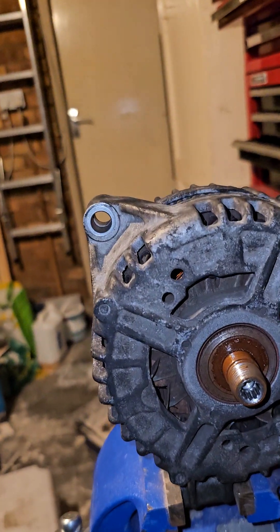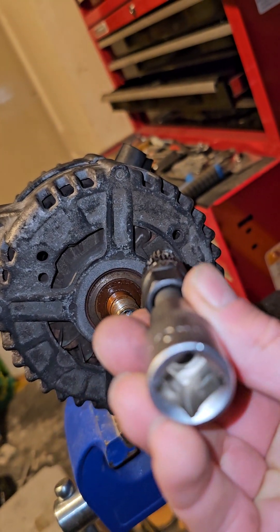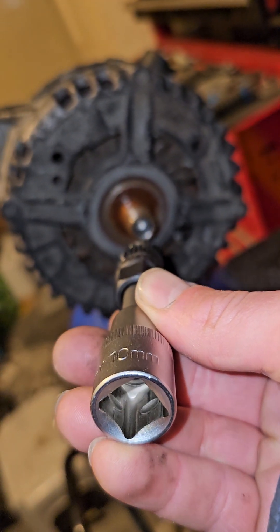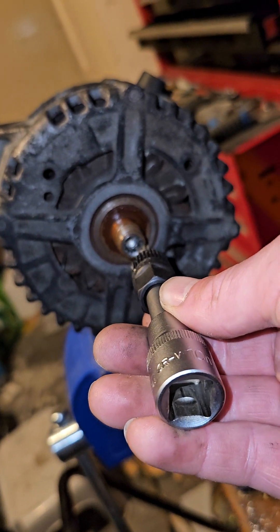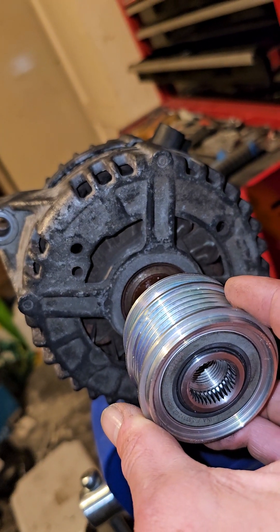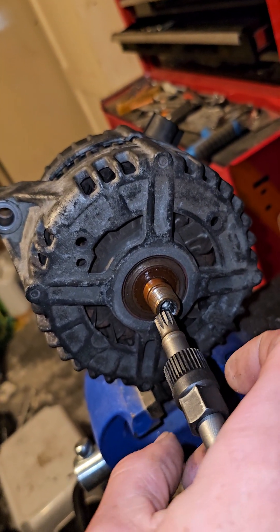For refitting, it's just a question of screwing the pulley on clockwise to the required torque value. I'll use a torque wrench in the half-inch socket. One thing to note: torque wrenches don't always apply the torque limiter when moved anti-clockwise, and mine does, but not all do — so be aware of that, since you'll be turning the driveshaft anti-clockwise to screw on the pulley. The torque value is approximately 85 Newton-metres.